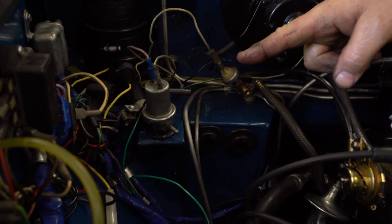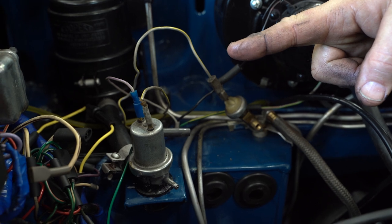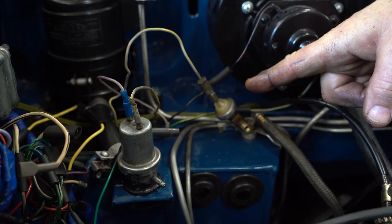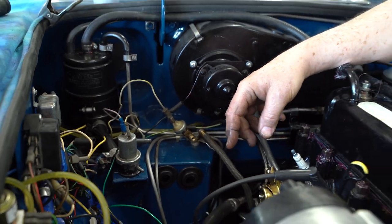The government doesn't want the car to run on when you turn the key off. Earlier MGs would ba-bum-ba-bum-ba-bum away. So the anti-run-on valve operates only when the key is off and when you have oil pressure. Here's the oil pressure switch — it's a slate/grey circuit which is keyed so that when the key is off you have power available at the switch. If you ground the switch because you've got oil pressure, then the switch operates. Right as you turn the key off, you come down to a stop, the engine's still spinning a little bit, you still have oil pressure, and that valve closes and stops the free movement of air through here into the engine.